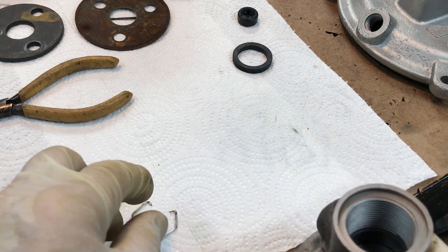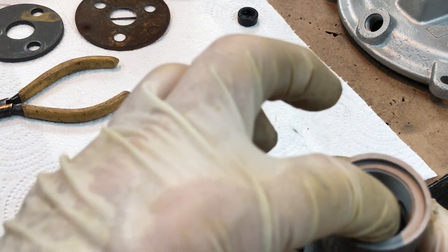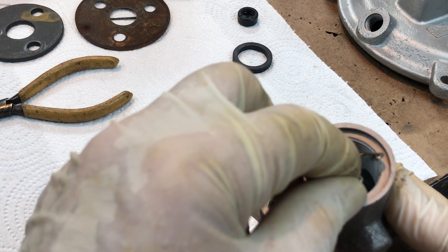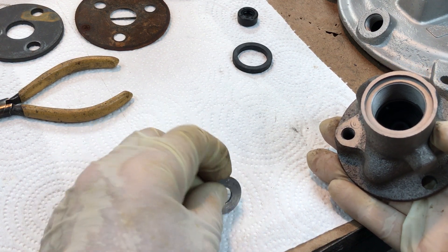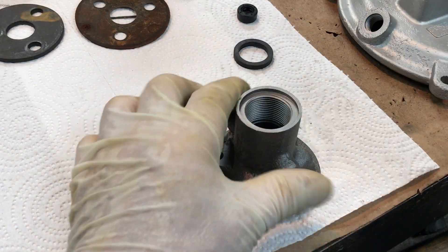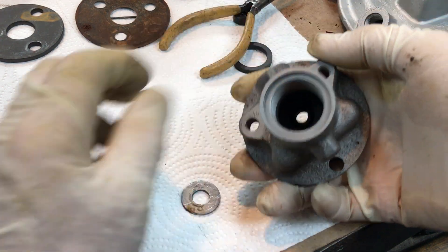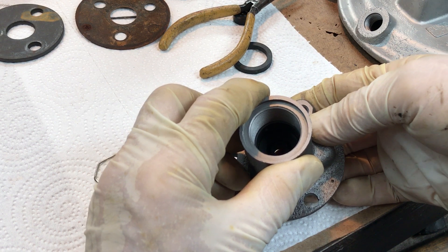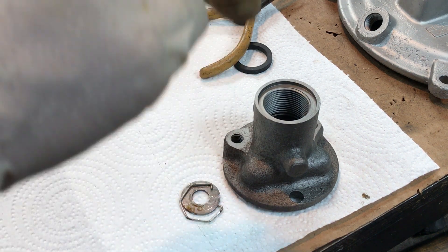The reason I mention that is because with this stack of parts, when you put this snap ring in place, you've got to press that snap ring and force it into the groove so that you're putting pressure on the stack of parts — because that's how it seals. If you can just put the snap ring in there without any effort, then there's a problem someplace. It can be corrected by either the thickness of this flat washer or by the thickness of the beveled washer down the bottom. The beveled washers do come in different thicknesses and different styles — some are fiber, some are aluminum with a smooth edge, and some are aluminum with a ridge on them. The important thing is when that snap ring goes into place, it has to be forced into the snap ring groove so everything is under compression.